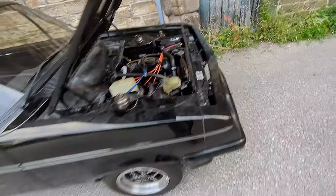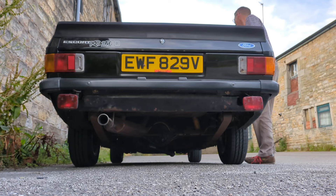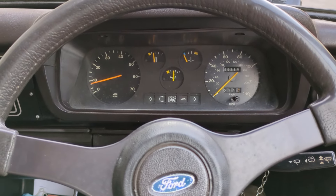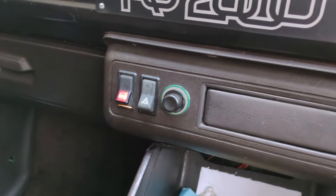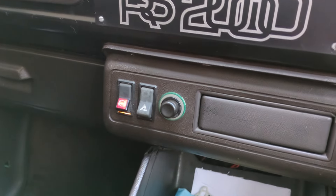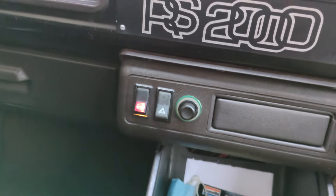So I'm going to fire it up now and hit the road. That's another job I need to do as well — that's telling me the brake fluid is getting low. That's because the master cylinder's leaking, not excessively, but it's at the low level. So I've got this warning light telling me it's going.